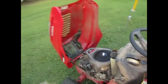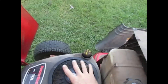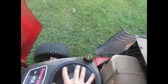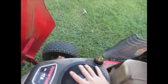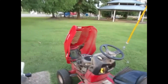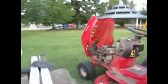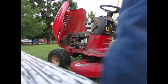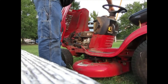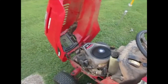What I just did there — I actually backed this motor up. Usually when these engines stop, they stop right at the compression stroke, which is the hardest position for this motor to turn over, so I always go counterclockwise until I feel resistance. Now it's ready to go, so I'll put my hand on the intake, get the motor spinning, take my hand off, and it'll start right up. So that's how you do it — it fires right up.